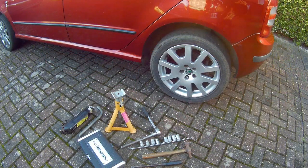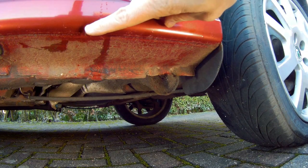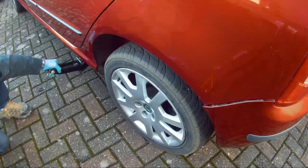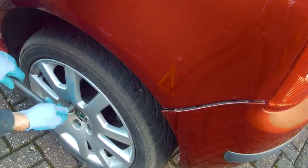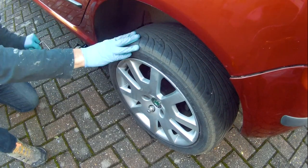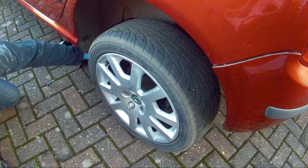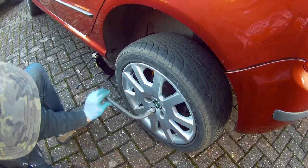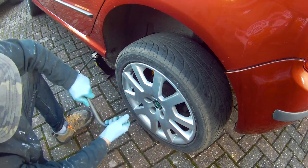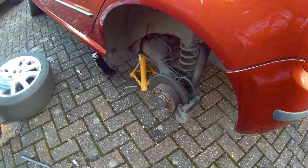First thing you want to do is find level firm ground and put the handbrake on, then chock the wheels both sides at the front. Then locate the indented mark close to the rear wheel arch and place your jack on the actual seam just slightly underneath that, and wind up the jack until it's firmly in place. Then break loose all the wheel nuts and re-tighten them so they're just nipped up. Jack up the car with the wheel off the ground by about two inches and put your axle stand in to make the car secure. Don't place it on any moving parts like the axle or the suspension arm, as we'll need this to move freely when we come to install the strut. Now go ahead and take the remaining wheel bolts out, take the wheel off and put it underneath the car for extra security.